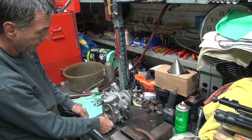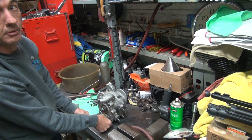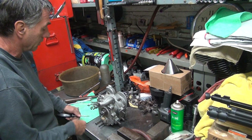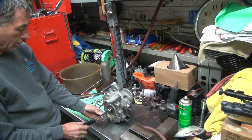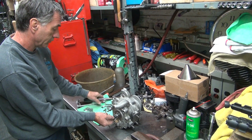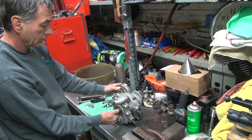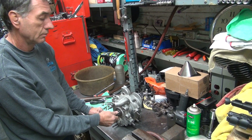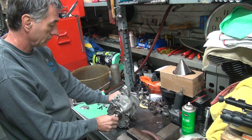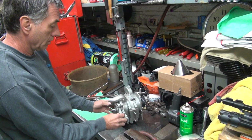Do you have the rubber in the end of this on the shaft? Yeah. That's probably the problem right there. They cause a lot of binding. You always put those in last after you're all done. Oh, didn't know that. It compresses against the counter shaft, which causes a lot of drag. How free is that now? Three or two. All right.